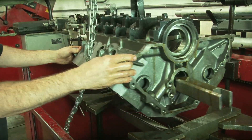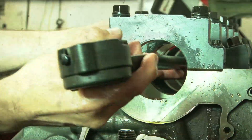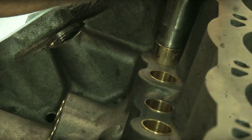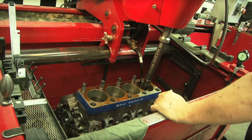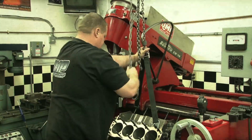I'm Brad Lagman, owner of QMP Racing Engines. We started with a Dart iron block with steel billet caps. In the machining process, we check the line hone — it's usually pretty good — but since we changed from bolts to studs, we had to reset the main clearance. We decked the block to establish proper deck height. We went a step further and put lifter bore bushings in it so the lifters ride on a bronze bushing instead of iron, giving us better clearance control and less oil leakage around the lifter bore. The block was honed to work with the Total Seal AP rings — it's a good basis to start with, especially when trying to make a lot of power. We try to emphasize that you want a good piece if you're going to make a lot of horsepower without failure.